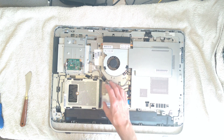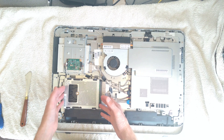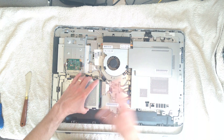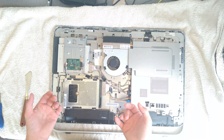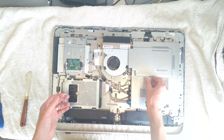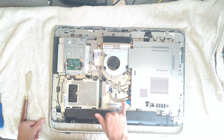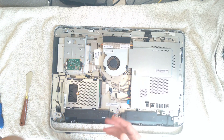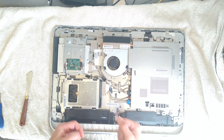The problem I've got with this machine is, when it's on, it corrupts data. You load it up, it'll start making clicking noises and then Windows won't load, or it'll crash the logon process, or all the fonts will be wonky. Hard disk testers — HDD Regenerator and Crystal Disk Info — don't report any disk errors, and MemTest 86 doesn't report any memory errors. So I suspect it might be either the cable or just the hard disk controller on the motherboard. But today what I plan to do is swap out the hard disk with an SSD anyway, just to make the whole machine quicker, and I'll monitor to see if the problem continues when the SSD is in there.